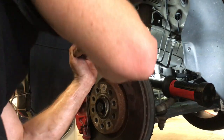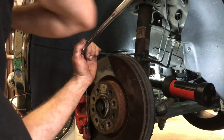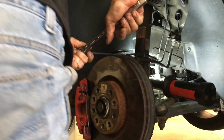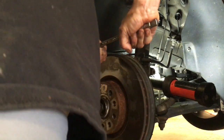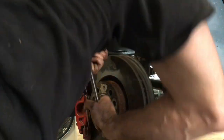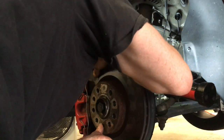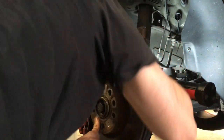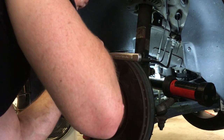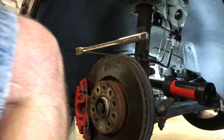You make gauges that you can put on to tell how many degrees of turn you put on them so that you can make sure you get the 90 degrees of turn. Okay, you holding? Yeah. But this, I think, is good enough. Let go. And hold them. This is the last one. Because a 90 degree turn is pretty easy, and so is a 180 that we'll be doing on the big nut at the end here.